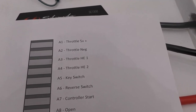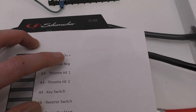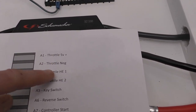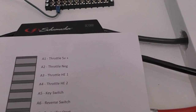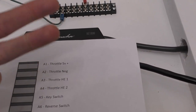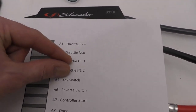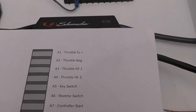That throttle cable is actually a hall effect throttle cable from a Toyota Prius pedal — a six conductor cable. A hall effect only needs three wires: a 5 volt positive, 5 volt negative, and the hall effect output, which is a zero to five volt signal indicating throttle position. This pedal has two redundant hall effect sensors, so it sends two complete sets of three wires. What I decided to do to save wires is share the 5 volt positive and negative between both sensors, so I still retain the redundancy of both hall effect sensors but don't send two redundant 5 volt supply wires — saving two wires.